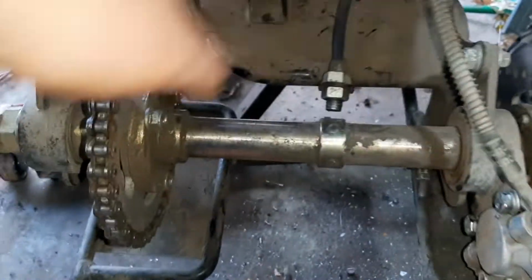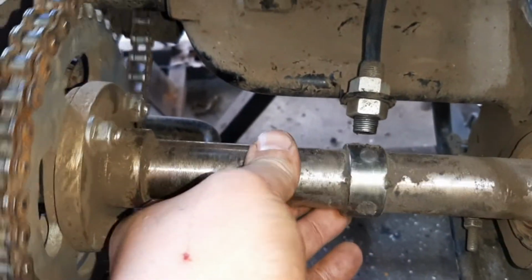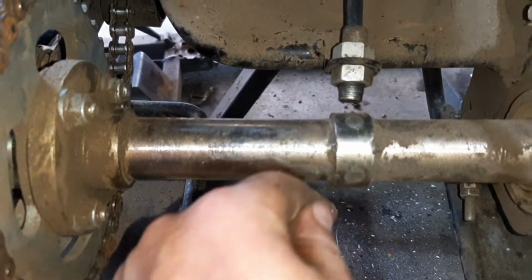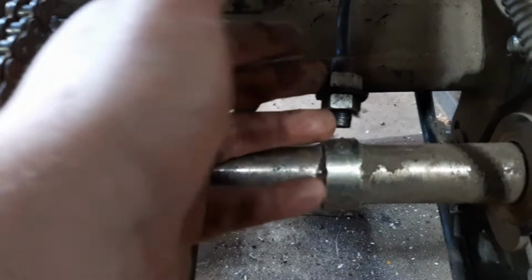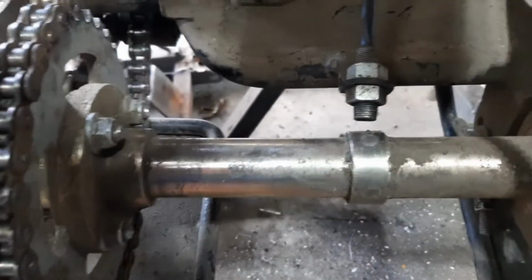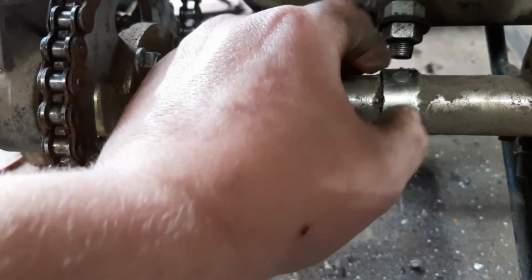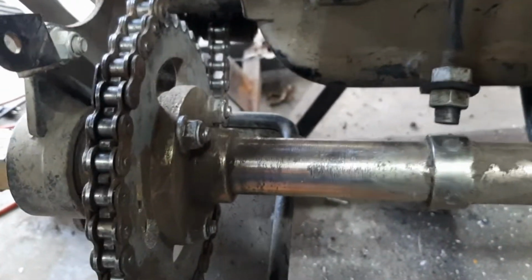So as I'm going back together here, guys, I was putting this back on, and when I took it off, I really didn't know what it was, but I rubbed some dirt off the axle, and I'm fairly certain that's the speedometer, and it's a Hall effect sensor, so as these magnets pass under this, it creates a voltage. And it sends the information back up through the wire. A lot like how an ABS or a wheel speed sensor works in a vehicle. Very much, it's the exact same thing. So that's pretty cool that a cheap Chinese four-wheeler from 2007 has that.